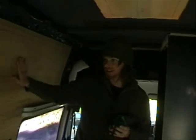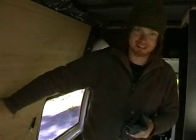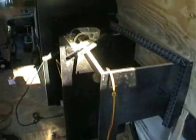Just line the walls with a 3mm ply on there and a 7mm ply on there because of the cupboards. Get the curves down in there. Built the two cupboards here to house the grill, the fridge, the sink, and gas tank and hot water system. So it's all moving along nice and steadily, like on the TV show.